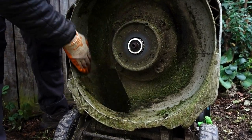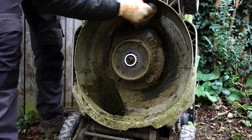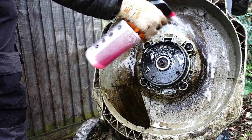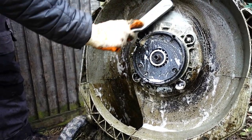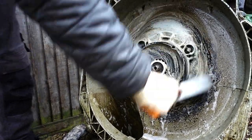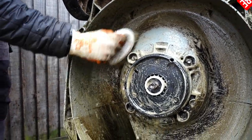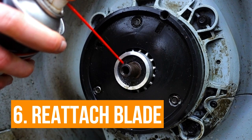To do the deck I've already got rid of a lot of the worst of it because it was really quite thick and horrible. I've again used the bike cleaner just to soften and lift all of that really ingrained dirt. I use a soft brush just to work that in and froth it up a little bit, then go over with a stiffer scrubbing brush because it really is stuck in. You don't have to do this, but it's good for lawn hygiene and it's going to make the mower work that little bit more efficiently, at least for the first cut. Just be careful not to get too much water on it. I do put a little bit of oil on some of the metal components just to stop them seizing.